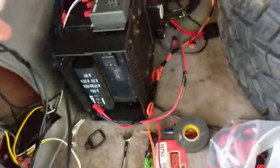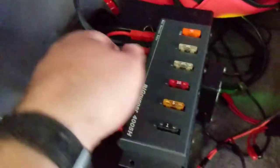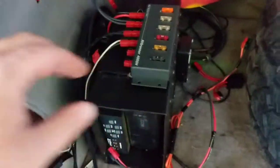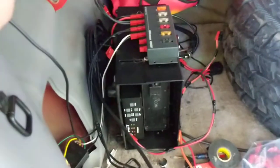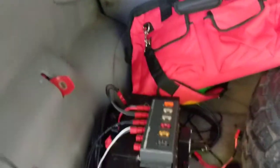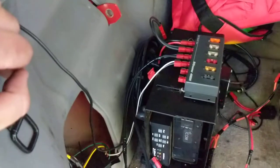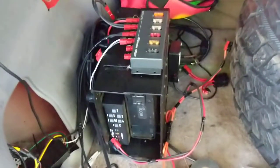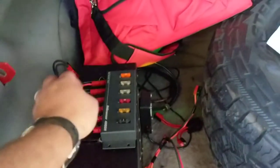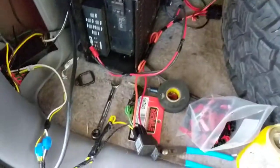This connection right here goes to the 12-volt and ground pins on my 7-pin connector down there. I'm feeding this with 25 amps — my research says trailer brakes draw probably eight to ten amps. You'll notice the vehicle is off and the keys are turned off, but we still have 12 volts because we're feeding right off the battery. That's not ideal — if anything is drawing 12 volts we'd either have to remember to come back and unplug this or risk a dead battery.